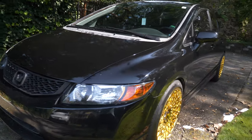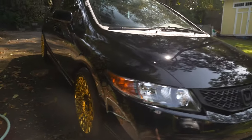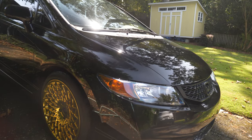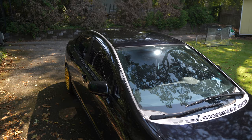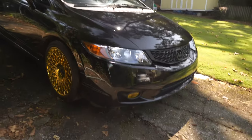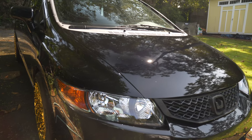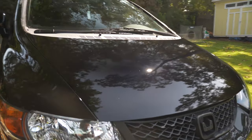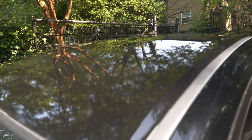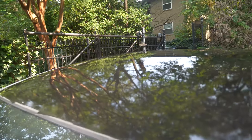As you can see, this is the hood and front fender. I'm going to get some close-up shots and let's see if you can see the roof on the car, and then we'll go back to the rear deck lid also. But it came out pretty good. I did not wet sand this clear at all. I thought if I did, it was going to look too nice compared to the rest of the car. It came out relatively well, in my opinion.